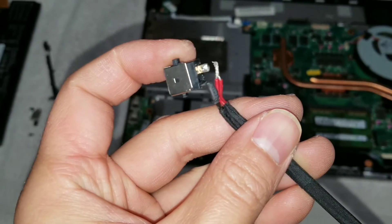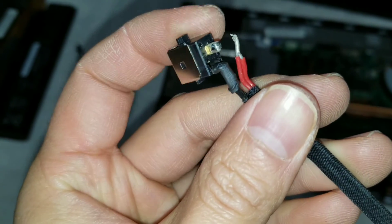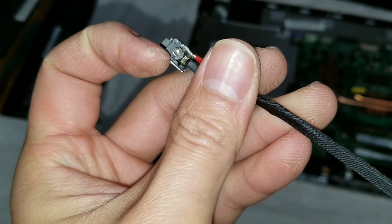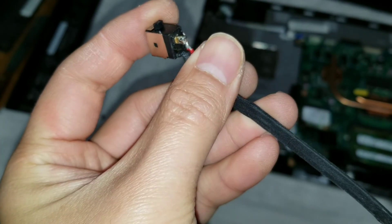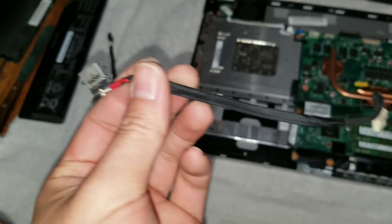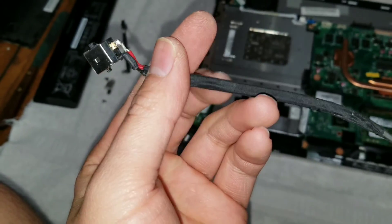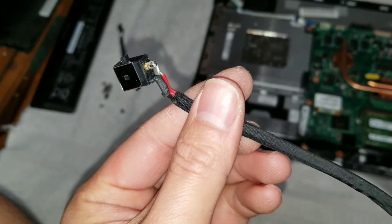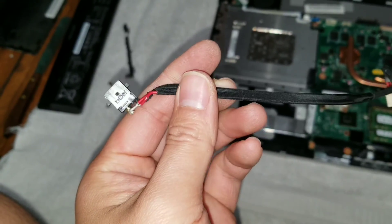I pulled the rubber piece off and found it actually did come loose — so it's a simple fix. Just solder it back together. If you don't know how to solder, look up some videos on soldering. The easiest way: add some flux to the end, heat it up, and the solder should flow back in place — you can add more solder if you want. Once I fix that, I'm going to put it back together. This part was pretty expensive compared to other DC jacks — about 15 bucks, whereas you can usually get them for less than 10 bucks. Since I can fix it, might as well. If you have any questions, write a comment below and I'll get to you as soon as I can. Thanks, bye.